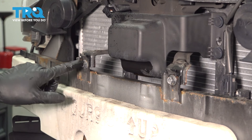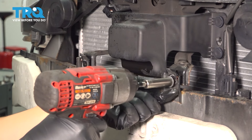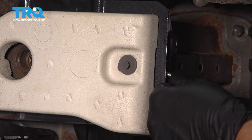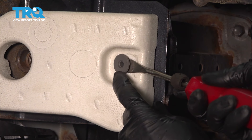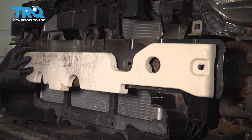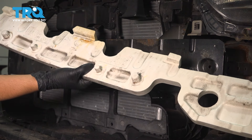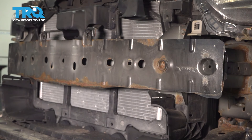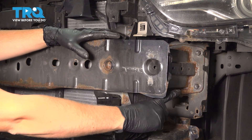In the center below the hood latch, you have two 10mm bolts — remove those. Next, I want to get this white styrofoam piece out of my way. On the back side, if you stick in a tool or screwdriver of some sort, you can push the center of the push clip out and pry out the outer piece. Do this to both sides and this should come right off. It has these little inserts here that kind of lock it in, but they're not actually locked in — they're just pressed in nice and snug. Set this aside.